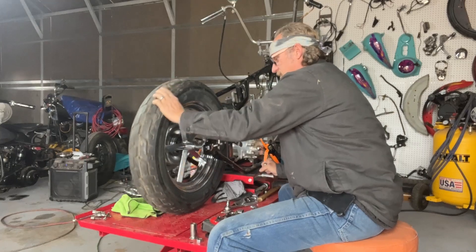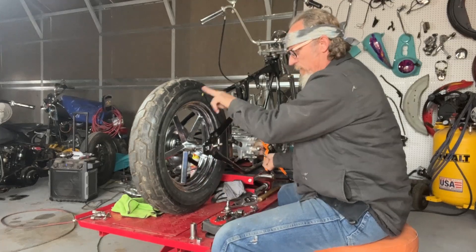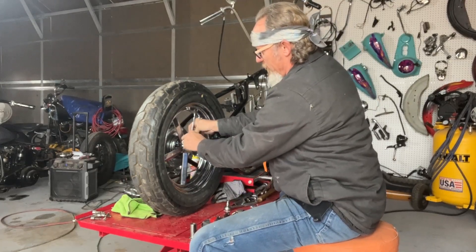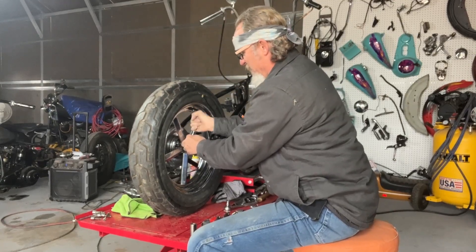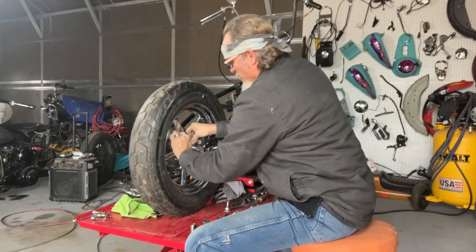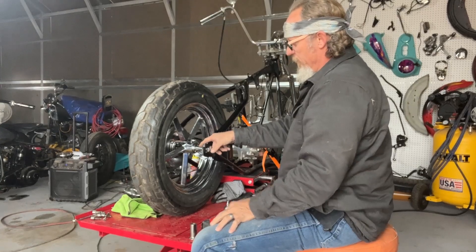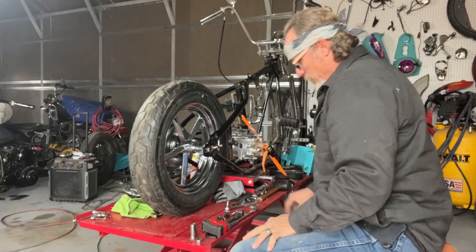Once I get these five bolts loose, I have to loosen them all in a sequence because they hit the spokes — I can't just take the bolt out. I have to do a few turns at a time to even get these off. The chrome bolts that were in here are actually about three-sixteenths of an inch longer than the colony bolts — same thread, just interesting. Now I've got all those loose. I've got to pull this axle and spacer off so I can walk this wheel out as I'm loosening these the rest of the way.